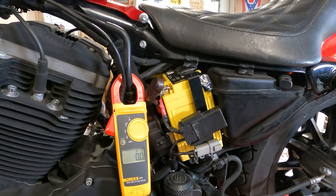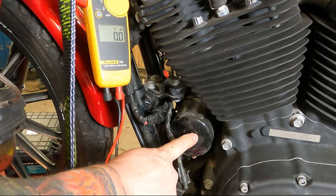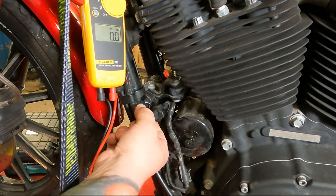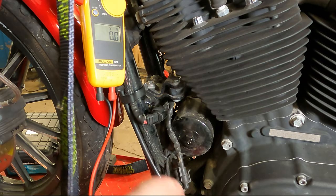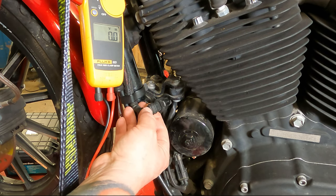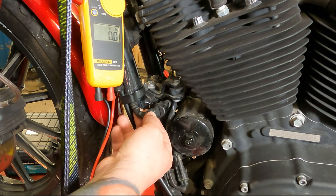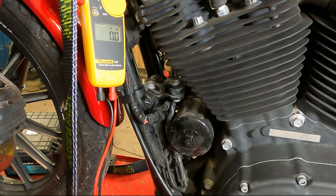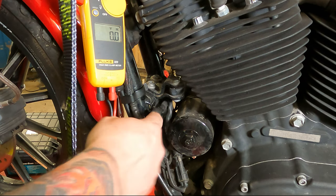Since we don't have a charging voltage going to the battery, we are going to move forward near the oil filter and check the voltage coming out of the charging system. Right here is your oil filter, this is the front frame rail, front wheel for reference. There is a quick connect right here below this engine mount — you'll see two here. This one's your O2 sensor, put that one back. And then this big, heavy gauge, rubbery looking one is the plug coming out of the regulator rectifier. The next stop for these wires is essentially the battery, so we're going to see if we have voltage here.